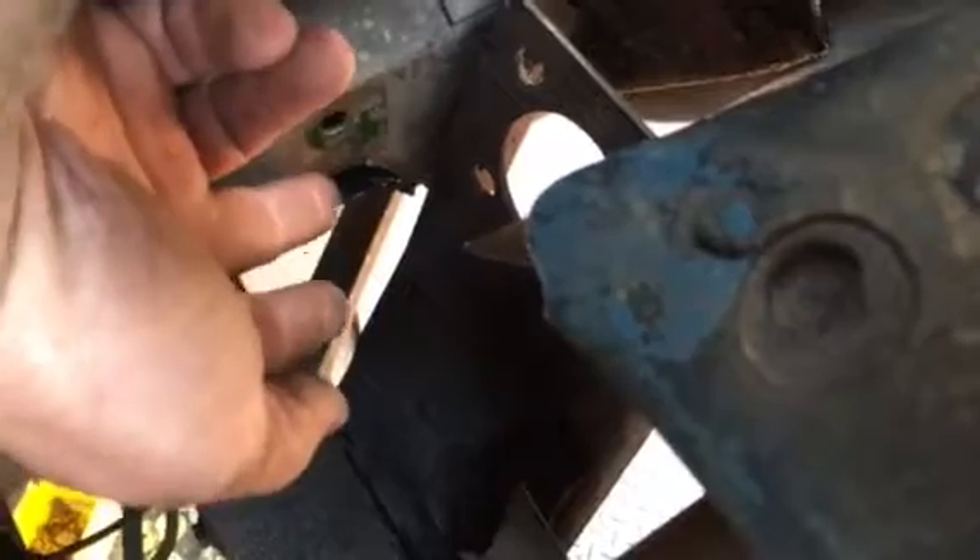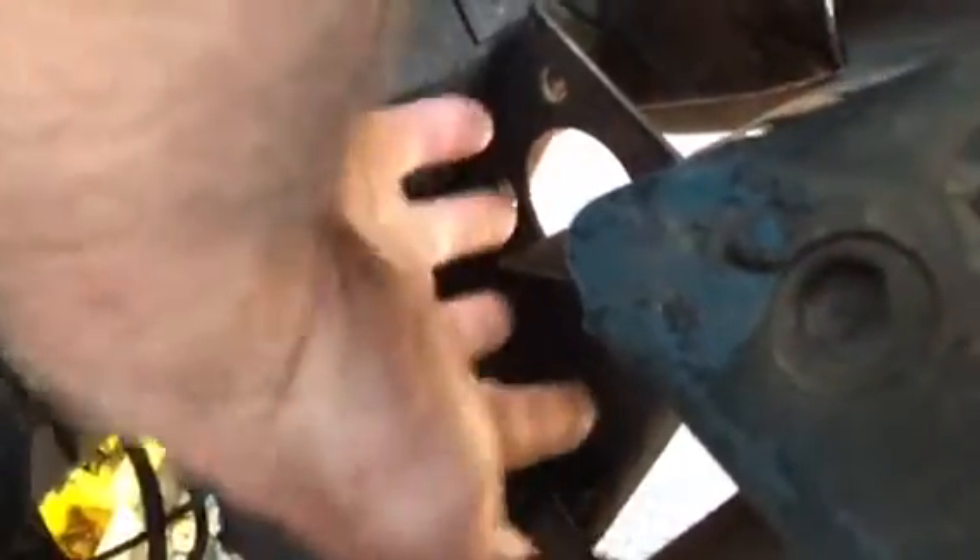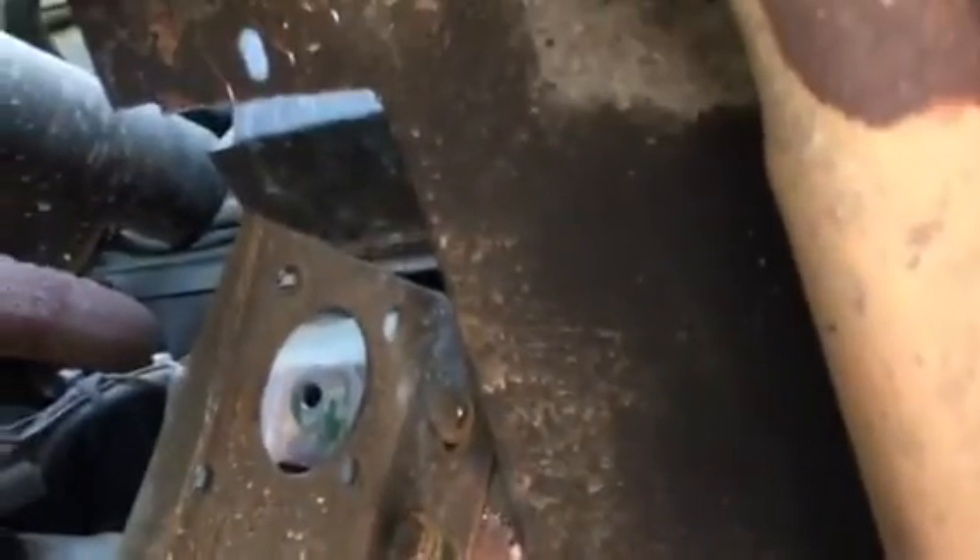So what we've done is what's needed, and in doing that I've made it to where the bulkhead stays down on the outside, which gives me a little bit more splash protection being outside than inside. But most importantly, it's going to let me have the flexibility of where the plumbing needs to go without this piece in the way. These splash guards are always a mess if they're original - you can see this one's already rotted out and barely in contact, so the cuts I made to make room for that, I'm totally okay with.